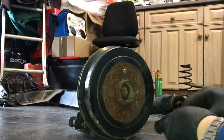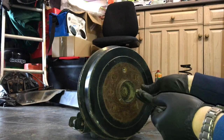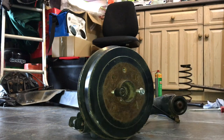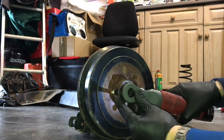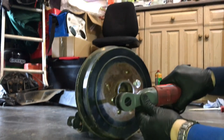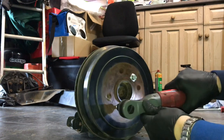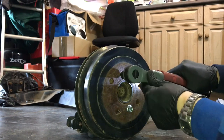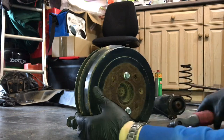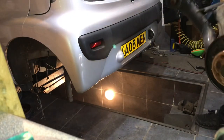The new axle must have been out in the rain a bit because the drum's pretty stuck. So what we'll do is use two M8 bolts, stick them in on both sides and wind them up — that just pulls the drum off. As they wind through they push it out — and in with the new.